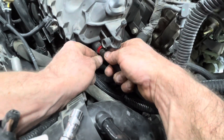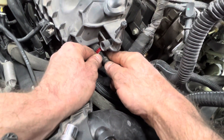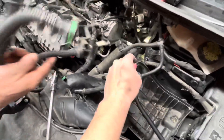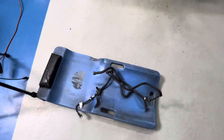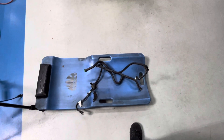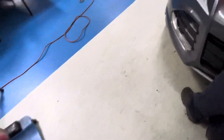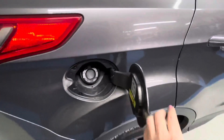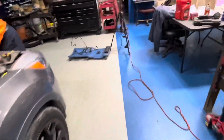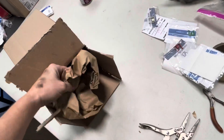This ain't a terribly old car. I could put a tool on it, run the risk of scratching the side and not sealing. You do not have to take the whole cowl off — or we didn't. So there's the old line. It started running really, really bad after you filled it up. The last time we filled it up it almost didn't start. All my research tells me it's because it overfills — this is a capless fuel tank. So once it clicks off, you stop it. Otherwise you can damage your charcoal filter, and it'll send debris up through the EVAP system.